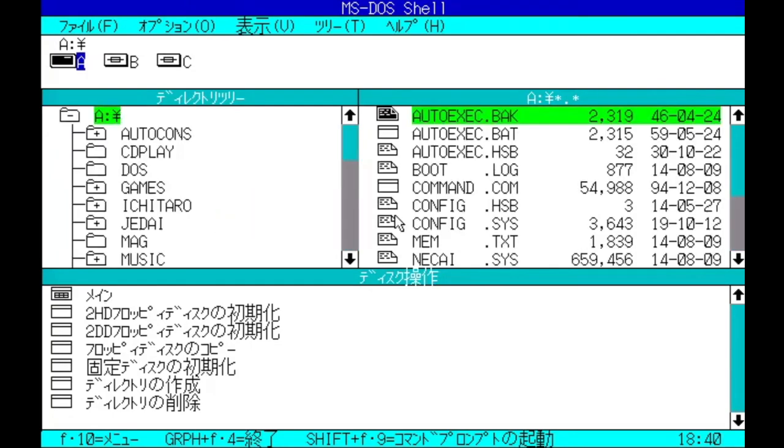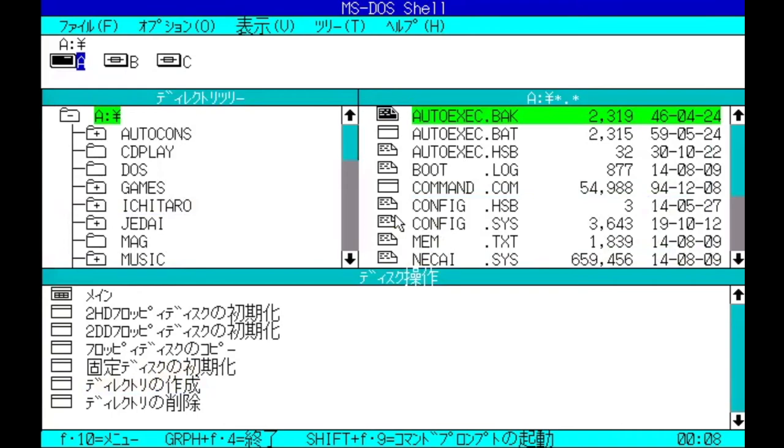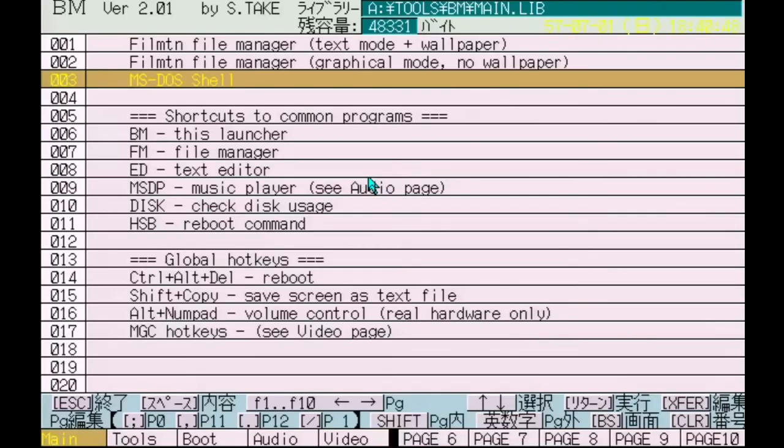Well, at least from my limited testing here, I can confidently say using a serial mouse is not recommended for a PC-98, although it will work in some very, very edge case situations. It will not work with most games, and most notably, it will not work with your video games, which you are probably playing on this computer. And the controls are different on this program.